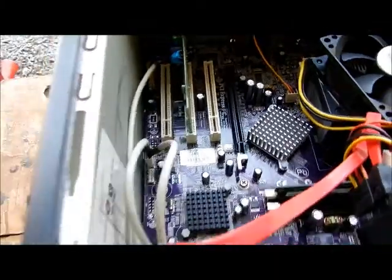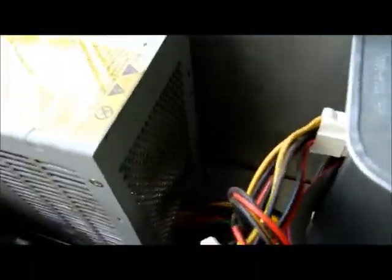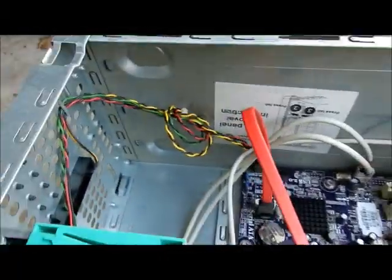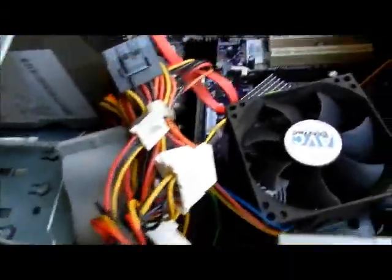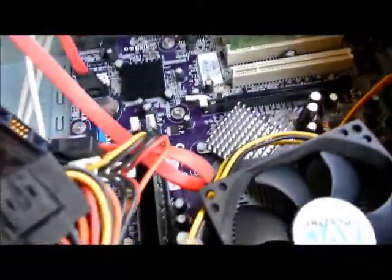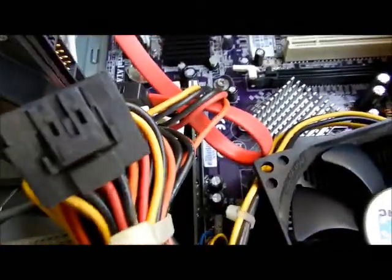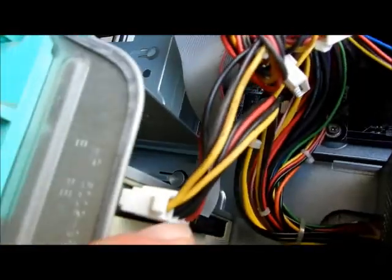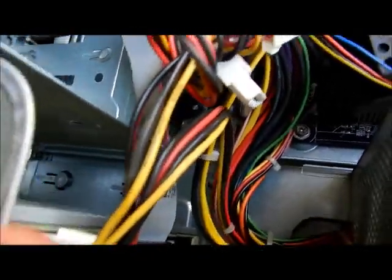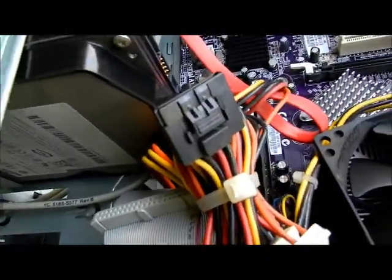The fan over here is all clean. This is the kind of stuff that comes included with the $50 to $100 I charge to fix computers — I never go over $100 on my labor. There's no evidence whatsoever of popped capacitors, like the Jiffy Pop popcorn, which is a good sign. There are two SATA plugs down there, and a mix of SATA and ATA plugs on here. The CD/DVD drive is ATA, and the hard drive is SATA. You could put a SATA CD-ROM drive or another hard drive in here and make it SATA 2 if you wish.